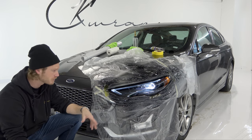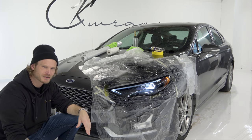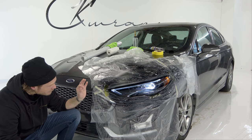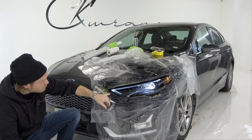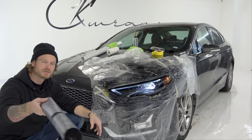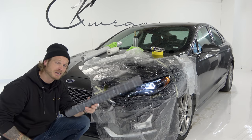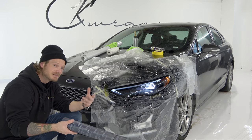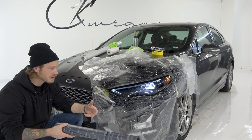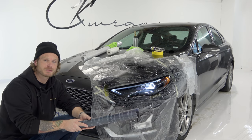I'm going to remove this — I want to let it dry a little first so it doesn't smear and make a mess. I do have brake fluid here so I'm going to dab it on a rag and wipe it off the lens carefully. I probably won't get all the tint off, but it is what it is. Anyway guys, I hope this video was informative in showing you the differences between VHT Nightshade and vinyl wrapping your headlights — time spent, cost efficiency, and so on. This is not something you want to do often without a mask. Thank you for watching — take care.